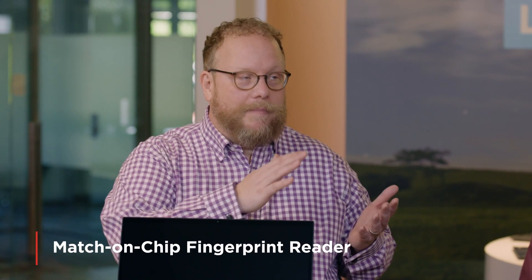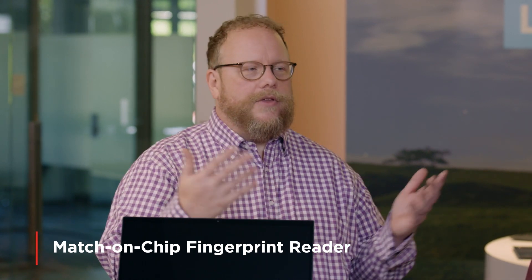These engineers are some of the most obsessive people — and I love working with them. Biometrics and fingerprints are becoming very popular, and this particular fingerprint reader is a very secure version. It's what's known as a match-on-chip fingerprint reader. Think about the three things a fingerprint reader needs to do: capture and store your fingerprints to establish identity, compare each subsequent scan against the originals, and then tell the operating system you're good to unlock. In a match-on-chip fingerprint reader, all of those actions occur solely and only within the fingerprint reader itself — there's no communication of that data to other parts of the system. It's walled off from everything, making it very, very secure.